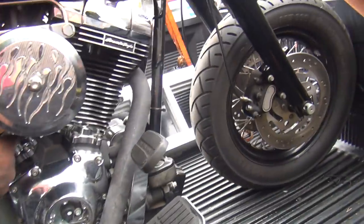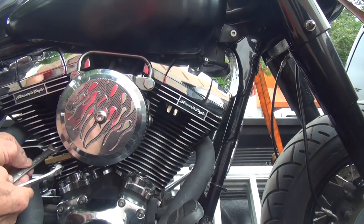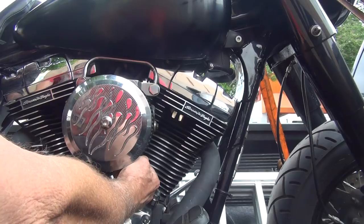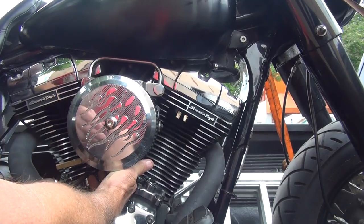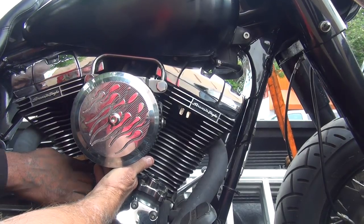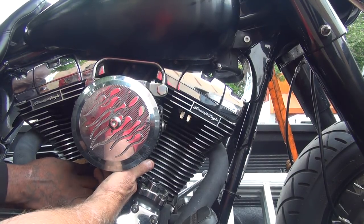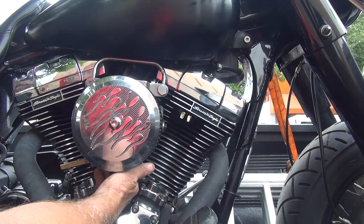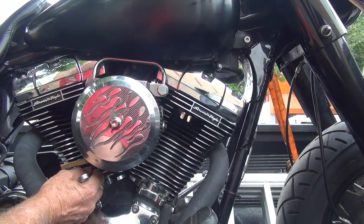In other words, like here — don't worry about that lock nut. So in other words you go: hold that one, hold this one, and this one you turn 15 flats. You turn that one 15 flats. This one? Right. So I should start from the base up here then? No, it's got to be after you've got nothing — no movement. Then it's 15 flats on the hydraulic. You pressurize it 15. But you're going to pressurize with the top one. Well, you can do it either way, but usually I count the flats on the bottom. It's 15 of these flats, not 15 of those flats.